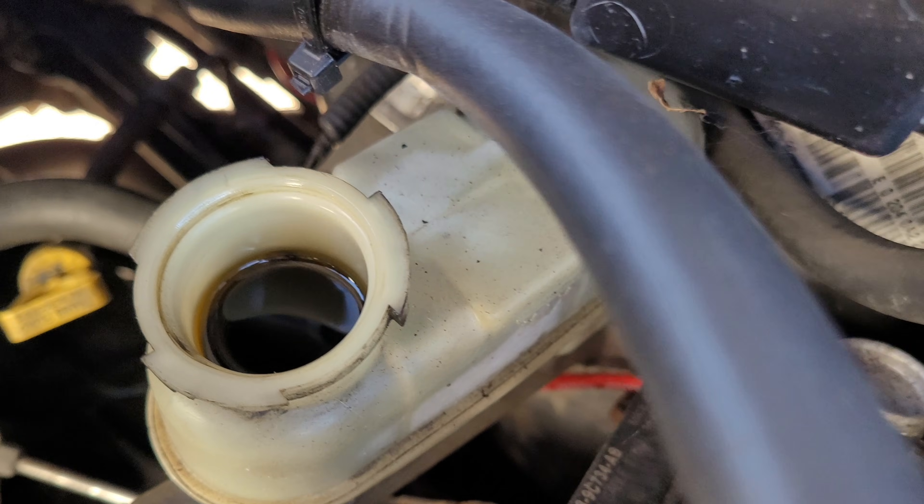I had to stop and think about this. We have all these different situations of brake fluid and they're all coming up roughly around the same — even a brand new bottle tested higher than my work truck. Is this tester accurate, or was that brake fluid just bad? My guess is the Dollar General brand actually had water in it coming straight from the factory. I think the tester works, and the other opened bottles have absorbed moisture from the air. The fact that I flushed my truck's brake system seven or eight months ago with good fluid supports that conclusion.